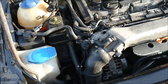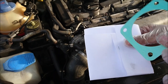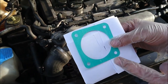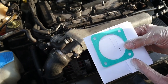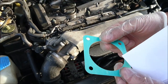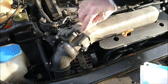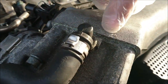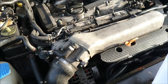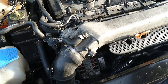Just before we go ahead, looking at what you'll need — this is what the gasket or seal looks like. And don't be cheap, change it. This cost us £4 from a VW parts specialist. It's not metal, it's made of card, so whatever's been in there has been in there for a long time. Don't try to reuse it because it's very flimsy. Replace it because you want a tight seal.